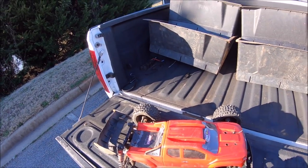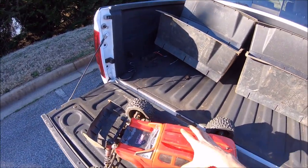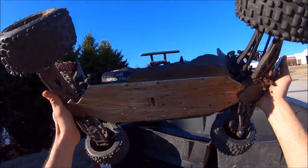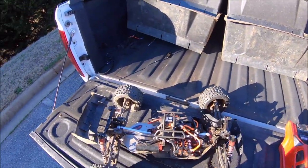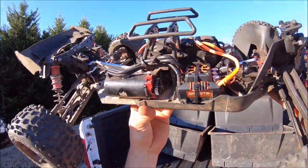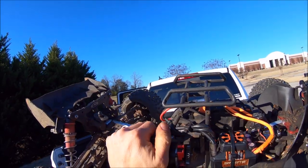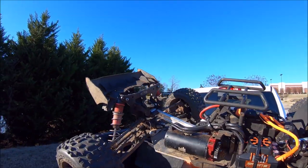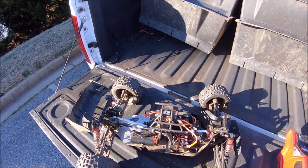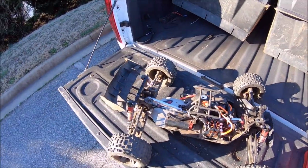I'm probably getting ready to hit the LVC too, and definitely don't want to do that in midair. But this thing is a complete blast — definitely a fun platform with the longer chassis. Again, it does have an M2C Mojave chassis on it; that's the only way I was able to do this, and it just created a complete animal. I'm not sure if I'm going to keep this Spectra motor in it because I had to gear it up quite tall — I had to put a 30-tooth pinion in it to get this thing moving and it is creating some heat. The ESC is not that bad but the motor is getting really hot. I do have a TP Power motor, a 4092 size, that will plug right into that ESC that I may use instead so I don't have to run such a big gear. But anyway, it was a blast — glad we were able to get out again, and I'll see you guys next time.